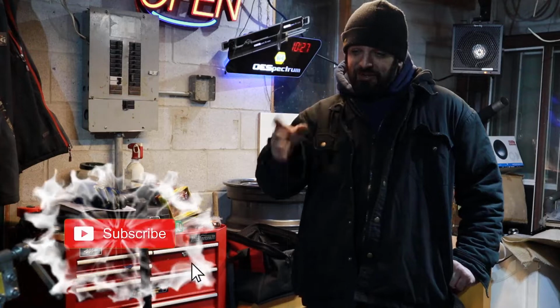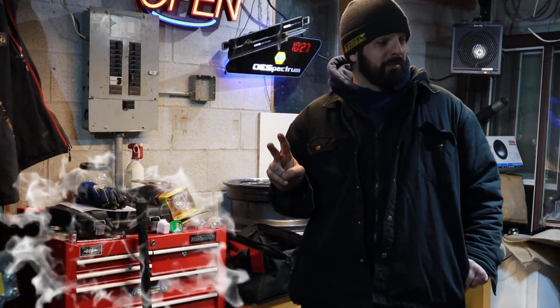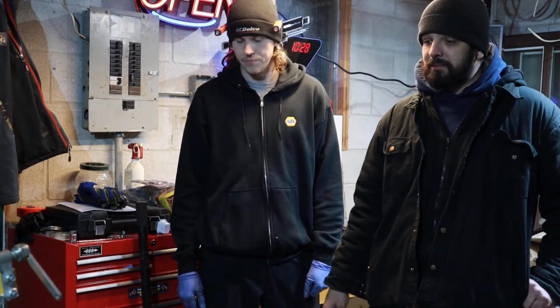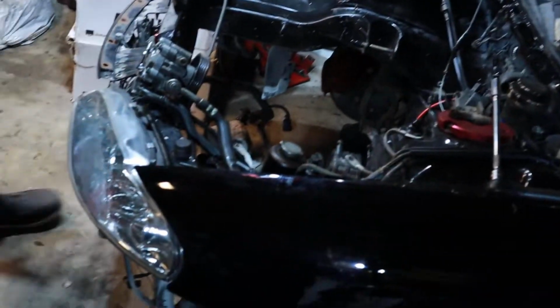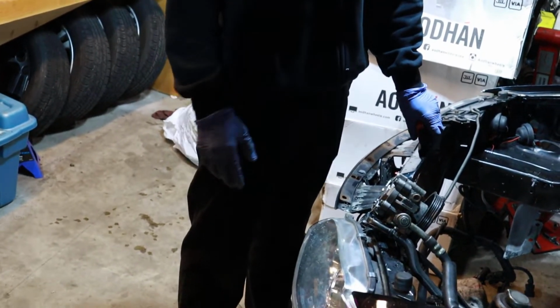So far we have the engine, the tranny mounted onto the engine, being held on with 2 bolts because that's all we could find when we picked up this car. Then we noticed the starter plate was not correct, hence why we had to pick up that one. We got the clutch installed, flywheel, and that's it so far. So tonight, this thing is going in. Hopefully for the last time, or for this round anyway.